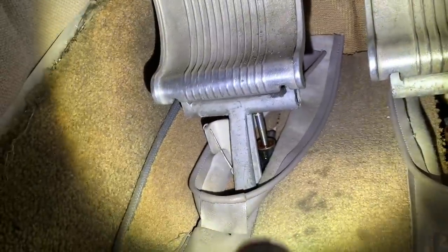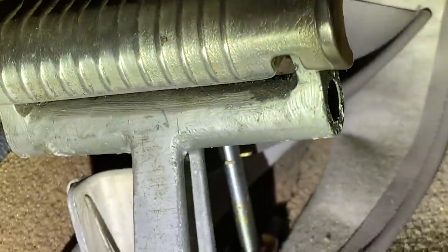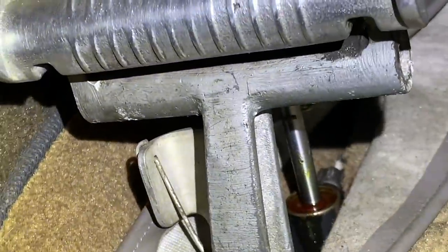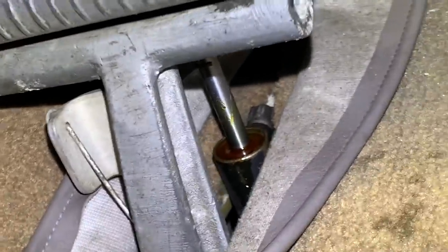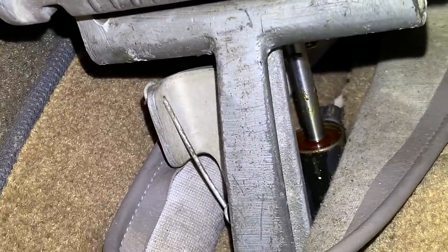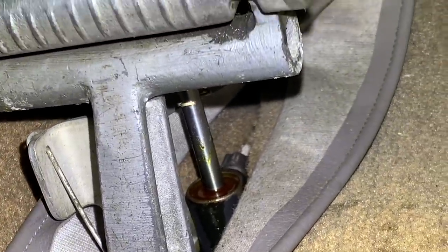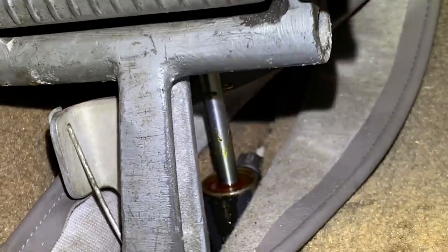The gear on this plane is electric, so the only thing hydraulic that could be leaking on the bottom of the plane is hydraulic fluid, and the only system that uses that is the brakes. You can see it pouring out the top right there. We're going to add rebuilding brakes to the squawks on this bird.